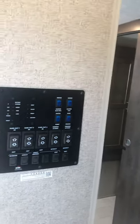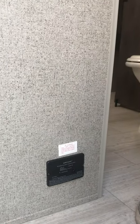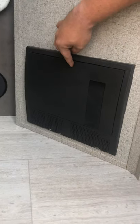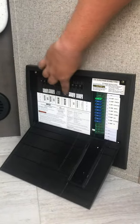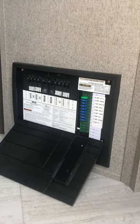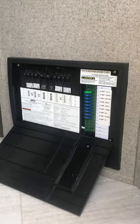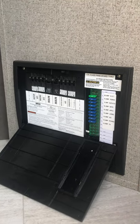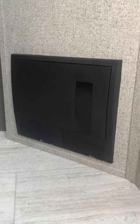Down below the wall we have a propane gas and carbon monoxide detector — that unit is hardwired in. Just to the left is your converter, which handles battery charging and onboard electrical. Push it in the center on top and it'll pop open. You've got all your 110 breakers labeled on the bottom, and the 12-volt fuses are on the right, labeled with what they go to and what amperage they require. There are also red LEDs next to each fuse — if you blow a fuse, it lights up red. There's a little window on the front cover so you can give it a rough glance to check for any red lights.